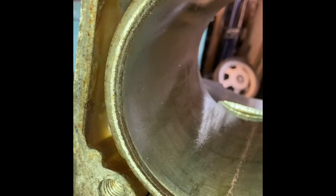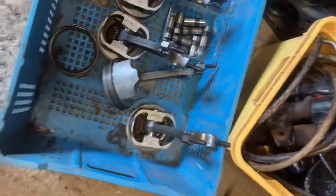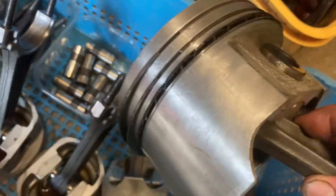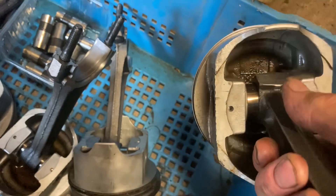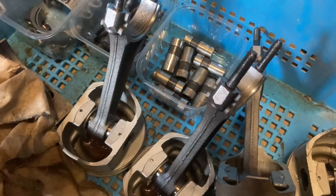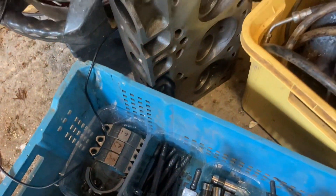Now it's just a case of having it on the top of a workbench — no engine hoist or anything like that — and trying to get all these bits back in. These are the pistons that came out of it. Again, no real big issues. The rings were all freed up nicely, so nothing's being replaced. Everything's been measured and checked to make sure it's all well within its tolerances. So hopefully this thing should just be a gasket set — a few odds and ends. I've got to try and get a few bits.